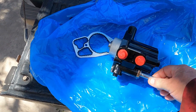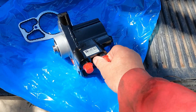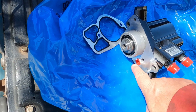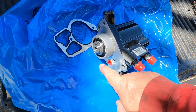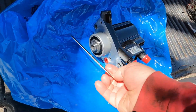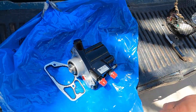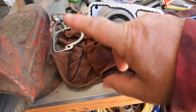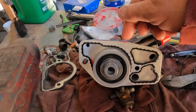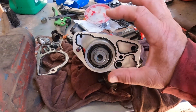There's my new high pressure oil pump - got that picked up. That's where your lines tap in here, your fittings. There are caps on here - two of them. Make sure you take that cap off - that's your supply for your oil to go to your pump, which fires the injectors. There's your new oil pump gasket, and that will sit something like that with that plastic cap off. I've got the gasket back on, one bolt sticking through, the other one filled back. I put thick wheel bearing grease on the backside - not the rubber part, just the metal part of the gasket. That'll help hold it stuck to there while we're trying to feed this pump in.